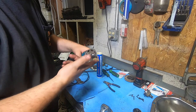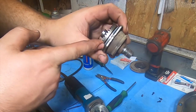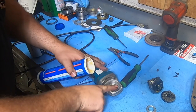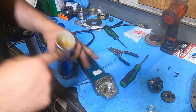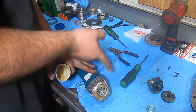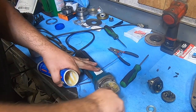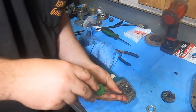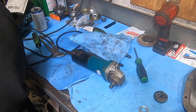Before you install your main cartridge, give the O-ring a peek — it's important because it keeps grease in and keeps crap out. I'm going to start with my finger and just get a bunch in there. I'd rather have too much grease than too little, because this lubrication literally lasts the life of the grinder. If you have one that's got a lot of age on it and it hasn't crapped the gears out yet, it might be worth pulling it apart, cleaning it out, and re-greasing it — you may get more life out of those gears. A little grease squeezing out — not too worried, it'll make space.